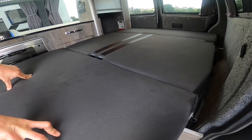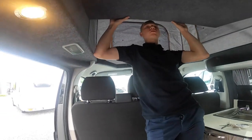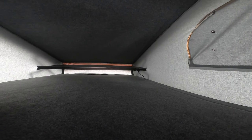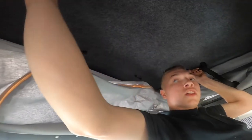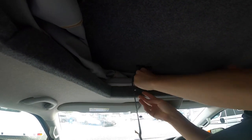To operate your pop top: this is your bed board where you put the mattress on to form the additional double bed at the top. Just unstrap the strap when using it to keep the canvas taut. When you want to put it down, pull the handles on both sides, pull it down so far, then pull the canvas in on the sides and the front to stop it getting nipped between the roof and the metal of the vehicle, then pull it all the way down. There are two straps — feed it through the loop here and the loop there.